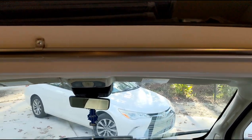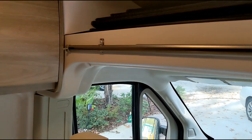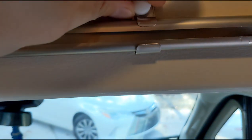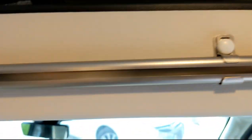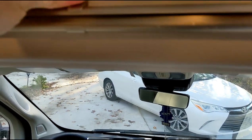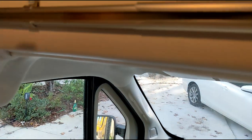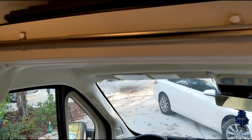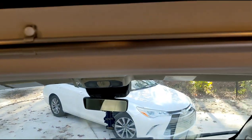As you can see it's installed — looking good, clean install. Where you removed the screws on the ProMaster, you have those little white covers that came with it; you just pop those right back on and it looks great. Easy install, 10–15 minutes. Now that I've told you about the out/out/in orientation for the attachments, that'll make it easier — I ran into that snag and had to move them around a few times. It goes in tight but snaps in perfectly fine and it's solid, it's going nowhere.